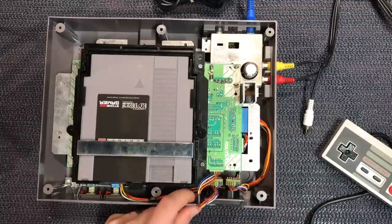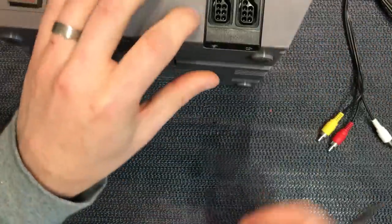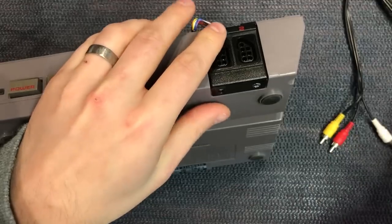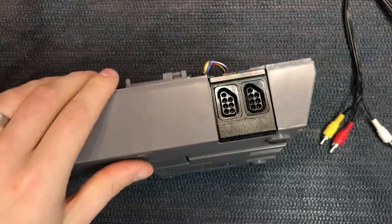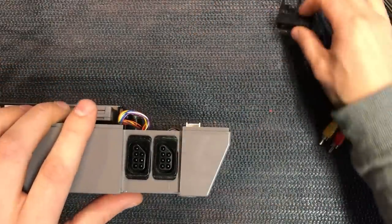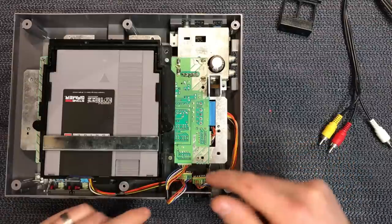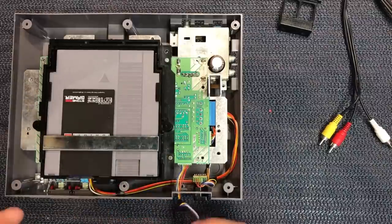Right now let's focus on these controller ports. What you need to do next is flip it up on its end, and you'll notice there are two Phillips head screws just underneath. Go ahead and back them out and put them in the dish — keep all the screws tidy. These ones are a little bit different so you won't get them mixed up, but it's good practice. Then this little black plastic shield will just lift up like that. Remove that and we get exposed to the controllers. Controller one plugs into the board here, and controller two runs around and plugs in over there.